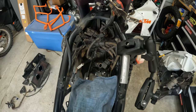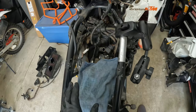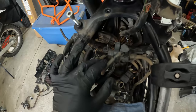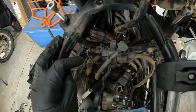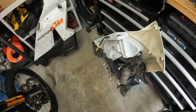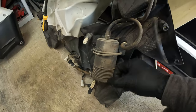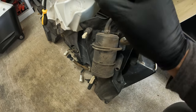We are working on the KTM 2011 990 Adventure today. We are replacing the intake system — we removed the SAS system off this bike and now we're going to remove the charcoal canister, or what they call the canisterectomy. The first thing you want to do is make sure your gas tanks are pulled off the bike, and inside the left gas tank you're going to have this canister right here, and this is what we want to remove.